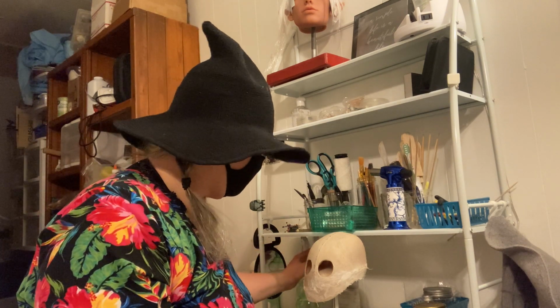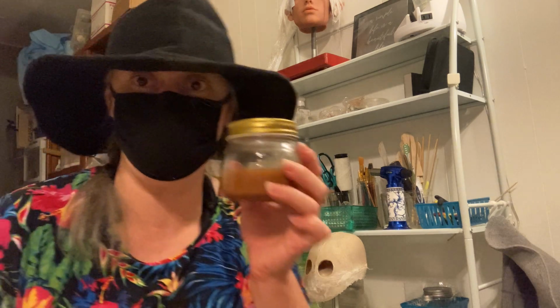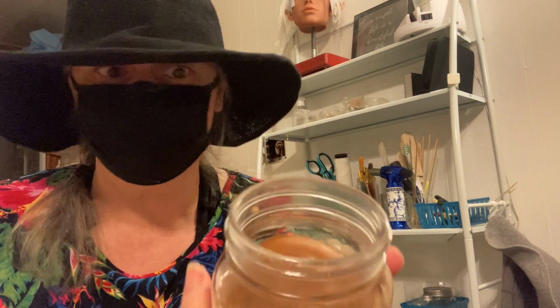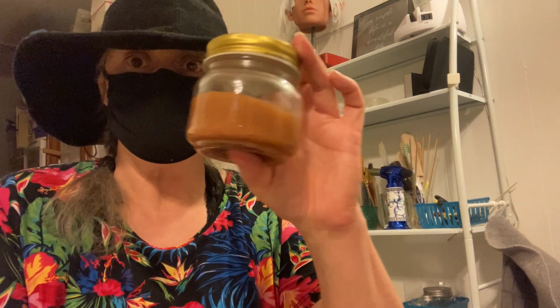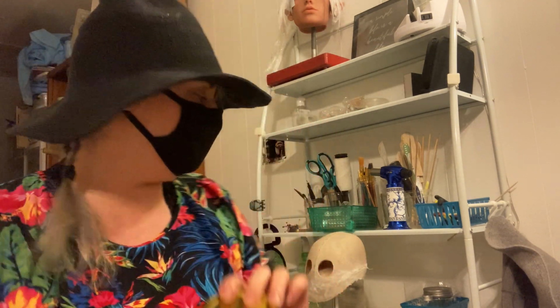For some repairs you can use straight primer. Other repairs you're going to need to make paste. And all paste is TPE. Ooh, this stuff stinks. With the primer in it, it melts it down. And that's how the primer works: it melts the TPE to bond it together. I'll make a video on when you would use this and when you would use the straight primer.